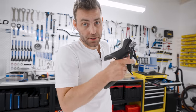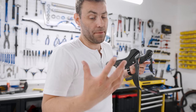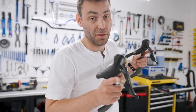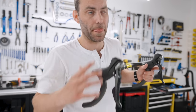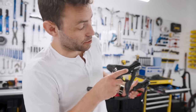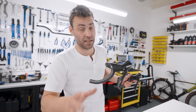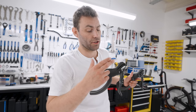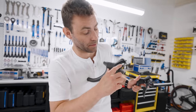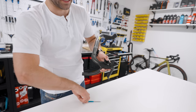If you're struggling to reach the brake levers on the drops, this is usually driven by handlebar width — you're reaching around the handlebar to get at the brake lever. However, if you do have particularly small hands, one way of potentially improving your ability to reach the brake lever might be to reduce the reach of the lever. How you go about doing this will vary from lever to lever. Check the model — in this case it's a Shimano Tiagra. SRAM and Shimano usually have the model noted on the lever itself, either on the blade or on the top. Peel the hood back and it's a two millimeter allen key.